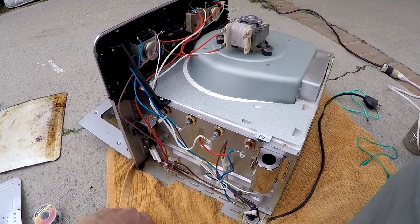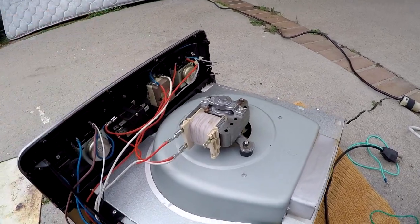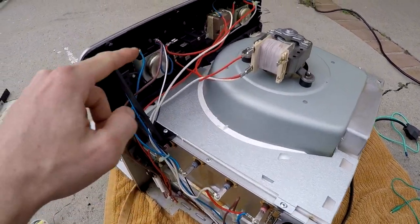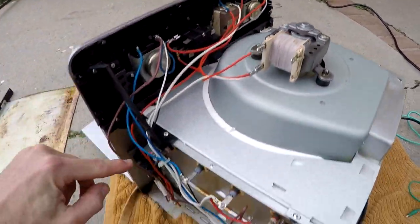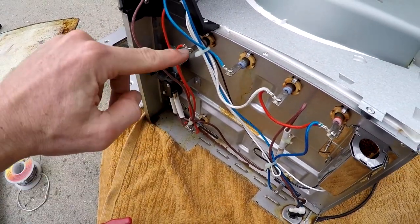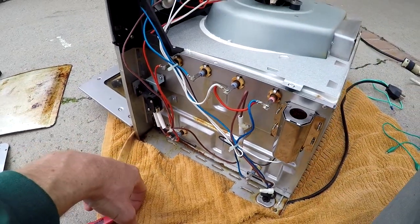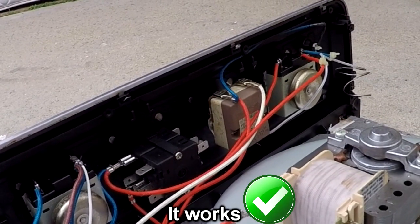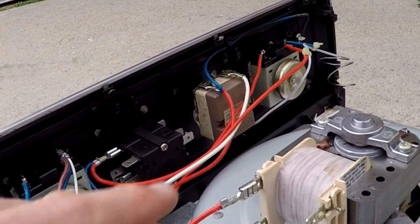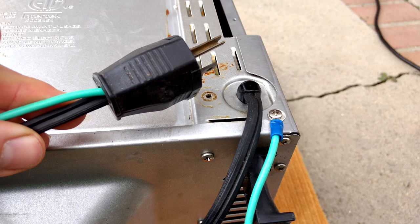I had to solder the main lead to this one, then it connects to this and this, and then the outlet from this one soldered onto here, the outlet from this one soldered onto here, and I made a new cable to bridge these two — or rather I just attached the terminal and now there's two hooked on there instead of just one. The light bulb functions like it normally should, and then the thermostat — I hope it works — that cuts the power off once the temperature sensor reads whatever temp you have it dialed to. I also added a grounded plug because metal-housed appliances are supposed to have one.